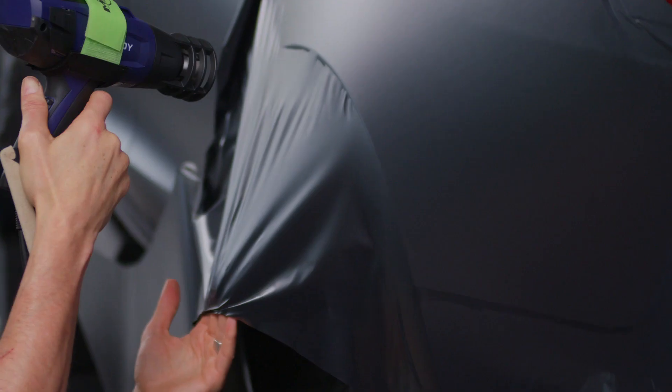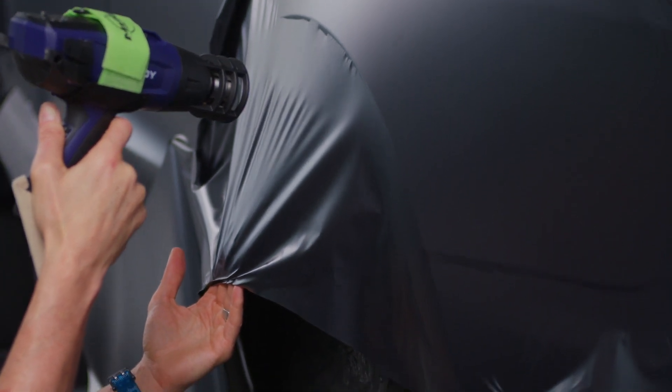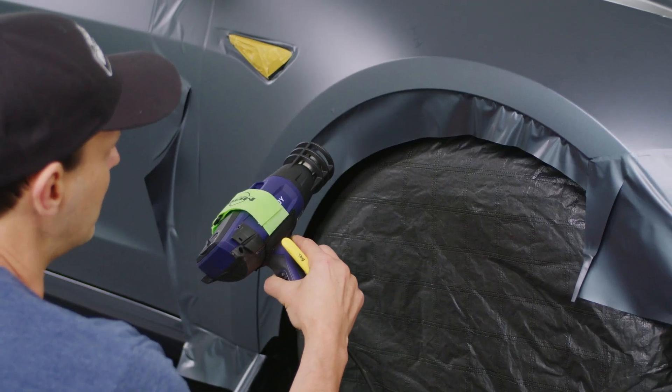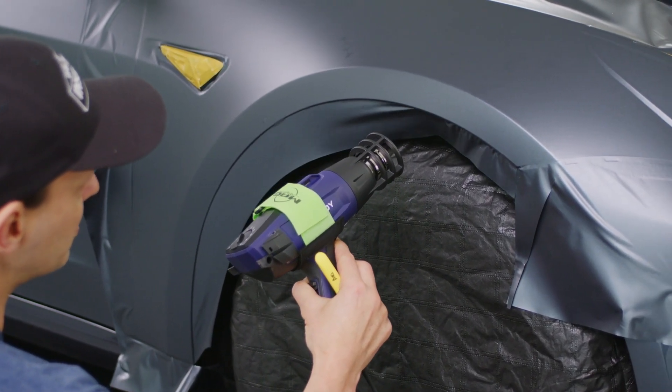What I like about it — as shown in the Tesla video — is that normally I glass out everything and pull it really tight. But with this film, I didn't, because of the stability and thickness. Instead, once I get to those points, I add heat and it literally shrinks into the car. So don't install Omega Skins like other brands with a full glass-out. Get it roughly on, get to the key points, then apply heat slowly and it really conforms where you want. When you get to the outside edge, there's no tension — you actually turn thickness into a good thing. Once it's on and done with heat, the gloss is gloss, the satins and mattes are beautiful, it looks like paint, and with that adhesive it stays for the long term.